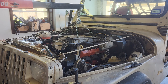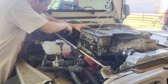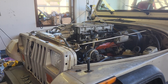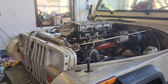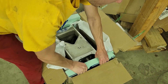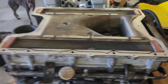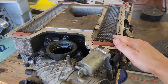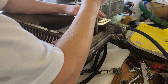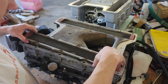With all the upgrades done to make sure I don't blow up another blower, it's time to replace the supercharger. There we go — spillage. I thought it all leaked out before I did this. I plugged up the intercooler, so hopefully it doesn't drip too much. We got the supercharger on the table, so we need to move the snout over, the intercooler bricks, the intercooler crossover, and the fuel rails.